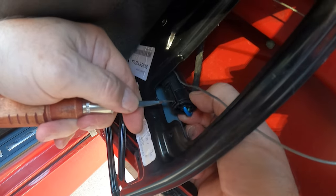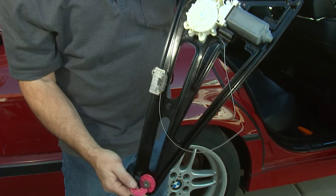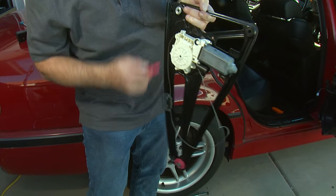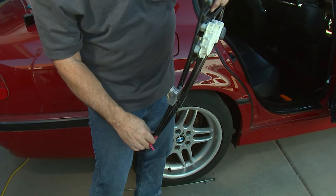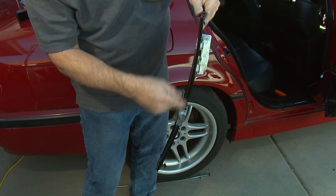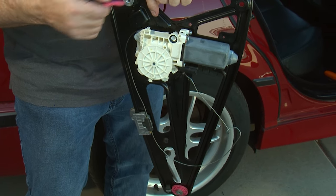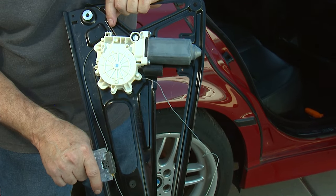There's a little tab right here, a little latch. Here's the window regulator — you can see the wire that goes down around this pulley here, and then there's this pulley up here which broke. That's a very common mechanism for these things falling apart. When it goes back in the car, this is where the window slides up and down. It's very common for these little pulleys to fracture and break — that's the most common failure mechanism.